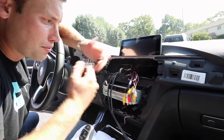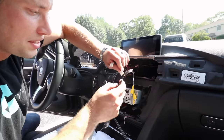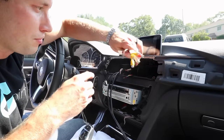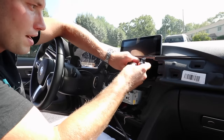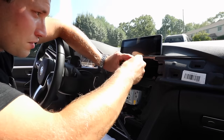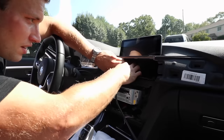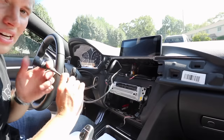If you're installing a rear view or front view camera, find the appropriate connection for power and the appropriate connection for the video feed. In this case we're just installing a SmartView, so go ahead and tape those connections and mount them out of the way. Wrap them in some 3M double-sided molding tape — it's padded so it won't rattle — and mount these to the side.